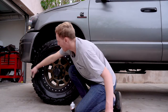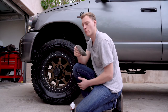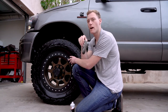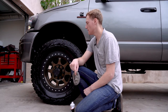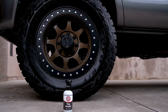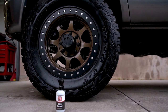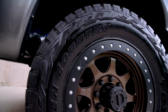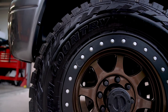Now that we've gotten good coverage on the tire, wait until it's totally dry and then come back if you want to reapply another coating. The more coatings you layer, the more shiny the tire will appear. One coating once dry is going to look just like a new tire. Two coatings gives a little more shine — that's usually what I find I like for my personal taste. Three coatings will give a little more, and so on. What's cool is this tire will look like this for the next one to two months. It doesn't matter what you do to it — rain, dirt, dust, anything — it will stay looking like this. This coating is also dry to the touch once dry and water repellent too. When I go out in the desert, run my truck around, come back, hose my tire off, and it looks like this. It's pretty impressive how it repels dirt and stuff.